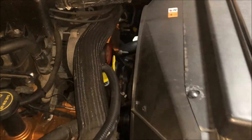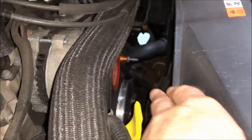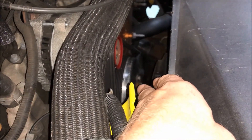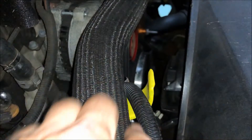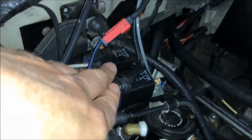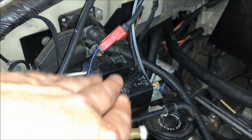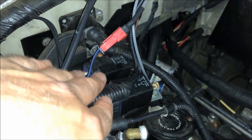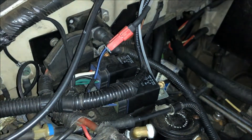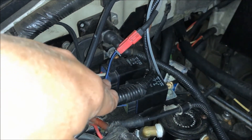Let's go down to the truck and I'll show you the installation. Out of the hood it looks like a pretty stock setup until you get close and you see there is the electric fan. There was a clutch-driven fan attached to that water pump — not there anymore. Here's the wiring harness coming off. The wiring harness goes up to the control function for this electric fan — this is where you have your on function for both temperature and air conditioning. This is where I was having problems with blown out relays.